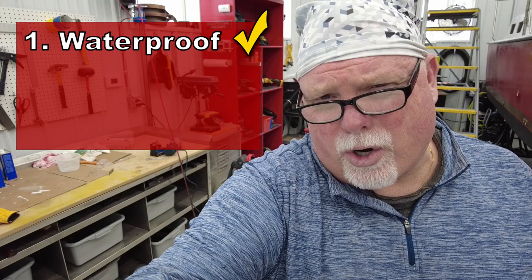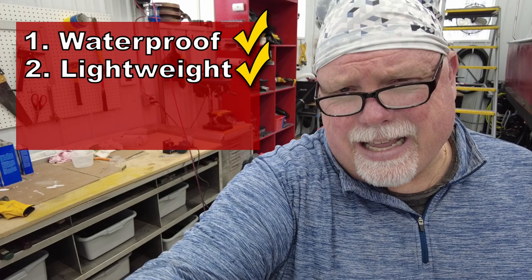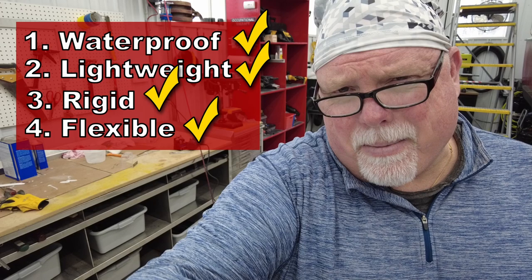There are several reasons why I chose Celtec for the material to build these cabinets instead of some of the other composite materials I sometimes choose. The first reason is that it's waterproof, and I don't want to worry about any sort of water or moisture problems down the road. The material is also lightweight, which is going to be an issue when I try to mount the cabinet to the underside of the cabin ceiling — it can't weigh too much. The third reason is that Celtec PVC foam board is rigid and holds its form really well. And the last reason, ironically, is that Celtec is also somewhat flexible — in half-inch thick dimensions it can be bent very slightly, which will come in handy when I try to get the cabinet facings to match the contour of the V-berth cabin hull.